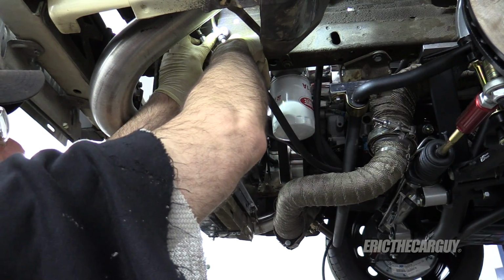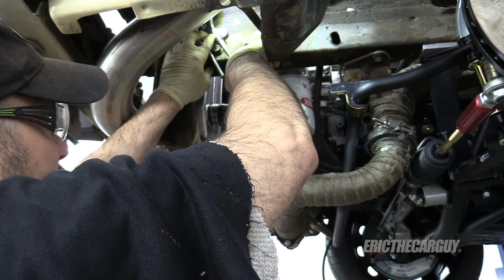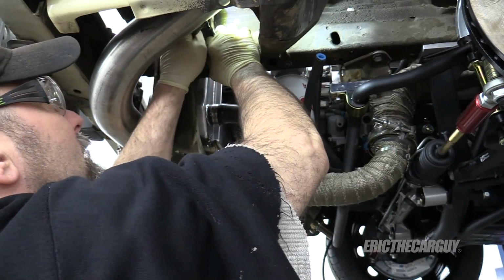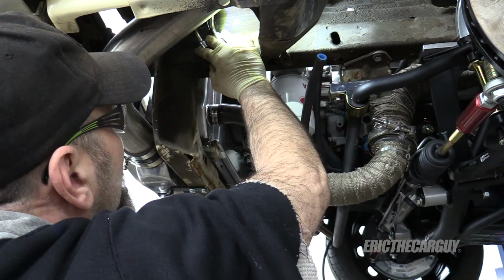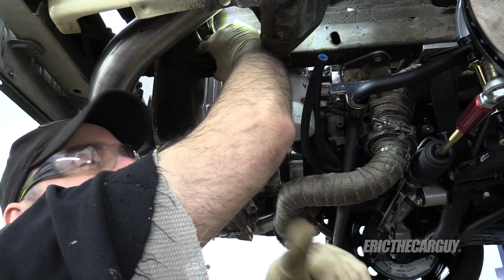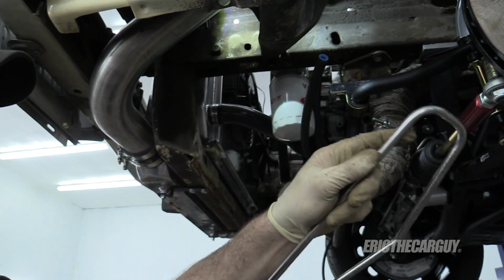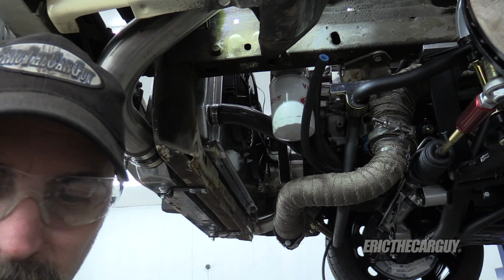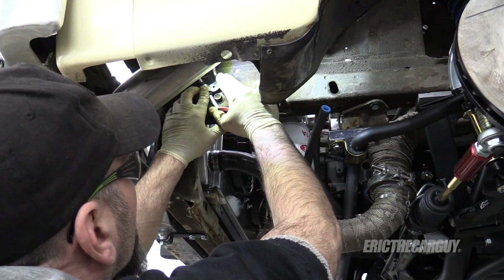Well, that's going to be in the way of the oil filter, but there's just no getting around that. If I'm not careful, I'm going to build a rattle right into this. I have to find a way to push this up and over. Once it's in, get it away from that fender. Or I got an idea. A piece of this same rubber hose, slide it up onto here in the spot where it could hit the fender, so that if it does hit the fender, it's hitting rubber. Ta-da! I'm gonna go cut me another piece to go on here. No more rattle.